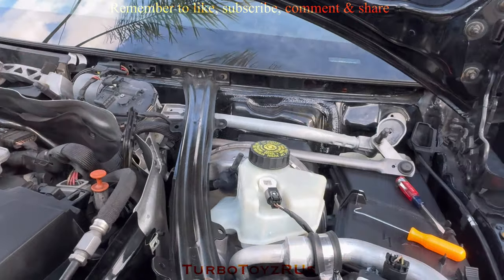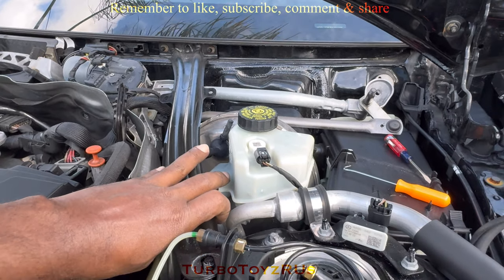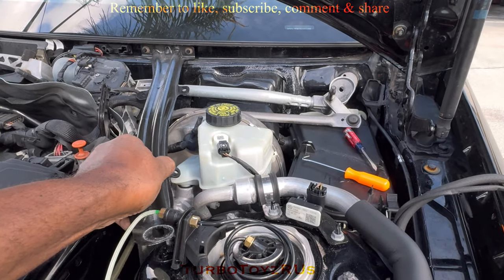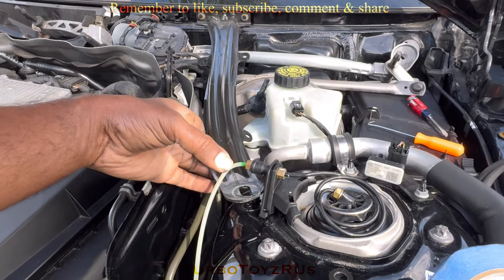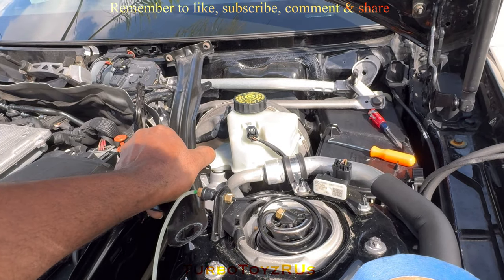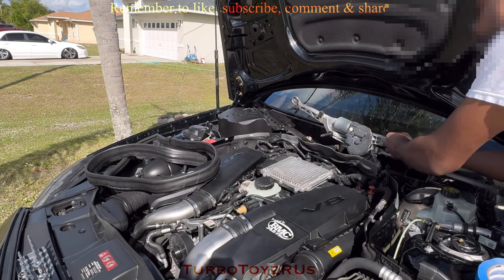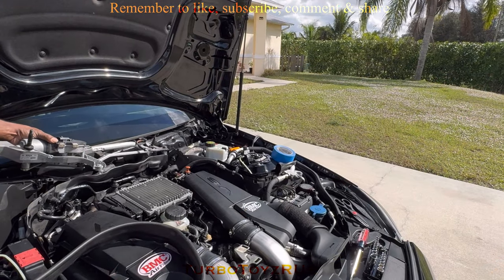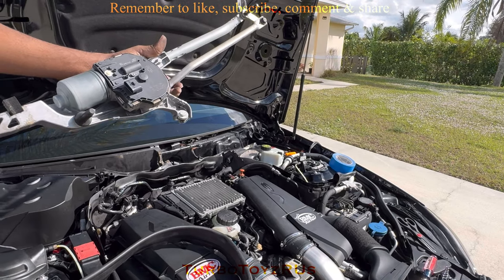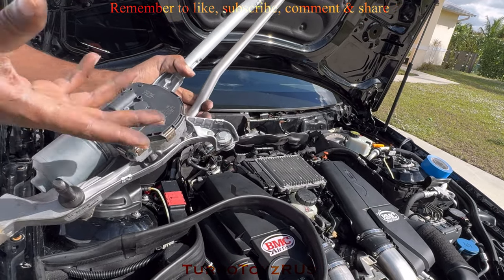Another thing we had to move in order to get this windshield wiper motor assembly out is this bar right here. This nut is a 16 millimeter or 5/8, just used my ratchet wrench. Pull this nut off — toward the firewall up there under the windshield there are two studs, so nothing to pull there, you're just going to ease this out and then wiggle it a little bit. Wiggle it nice and gentle — remember your line is right here so you don't want to go too crazy because you can crack that very easily. This is the wiper motor assembly — arms, motor, and everything.